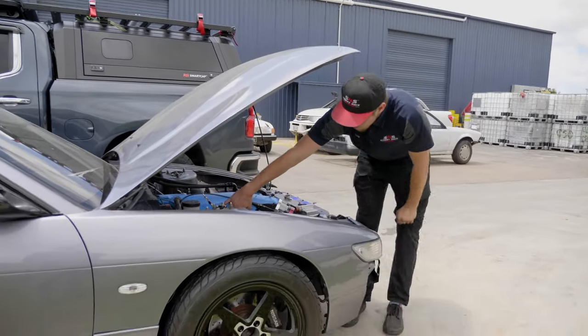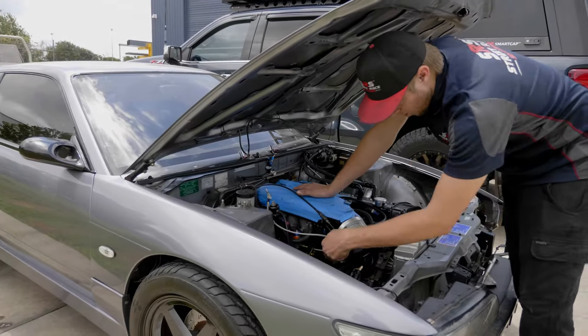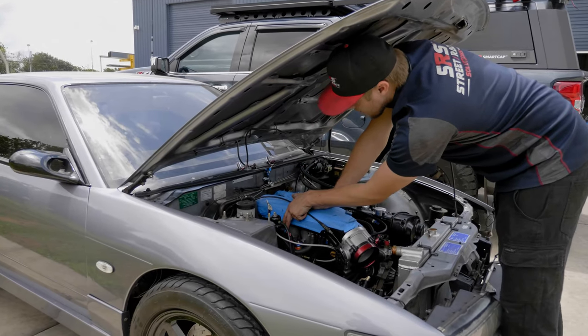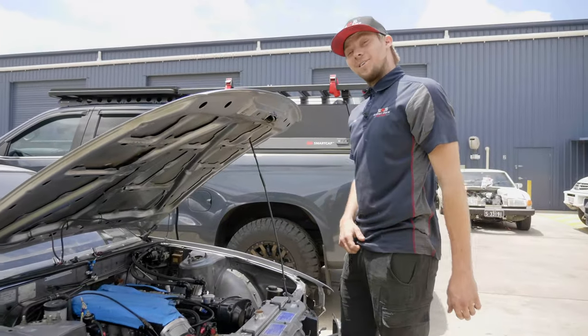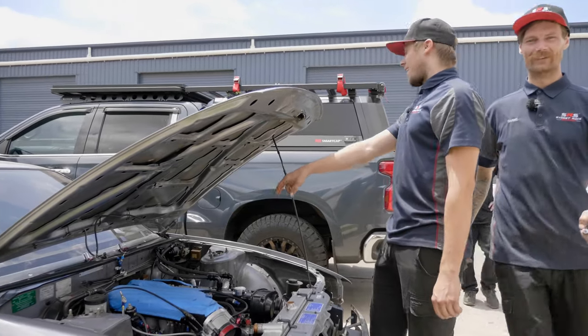We've got our nitrous solenoid just here. So the nitrous solenoid there, the line runs forward and it goes into the pipe right about here, which you can't see because the pipe's not there. On the back of the nitrous solenoid itself, we've got our purge solenoid. The purge solenoid then comes along here in this AN line up to our Ntimidator, not Intimidator, just an N. There's no I in front of it, which is a bit weird. So this is the Ntimidator nitrous purge kit.